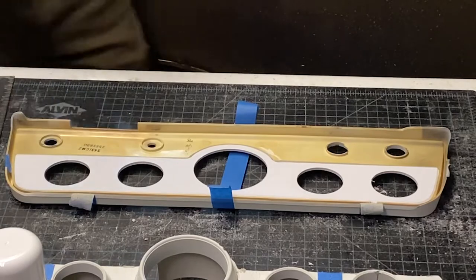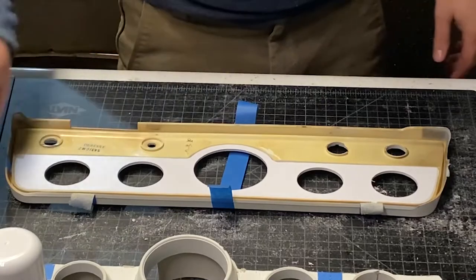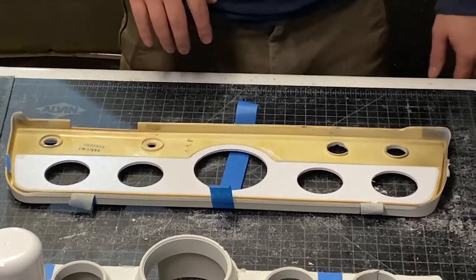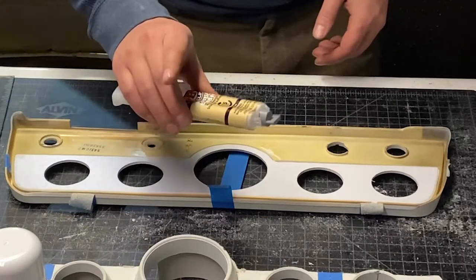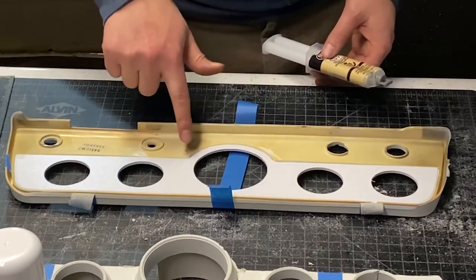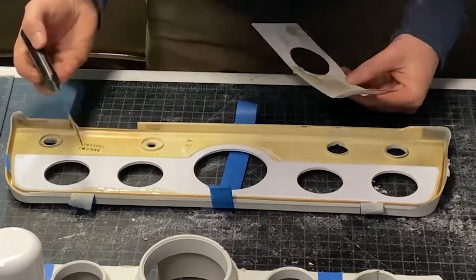Okay. I got a nice chamfer on the back edge here, similar to what you would do if you were welding a couple thick pieces of steel. Get a chamfer so that you can get weld down in there. Got a piece of tape to hold the top edge in, and I'm gonna mix up some of our epoxy, and I think I'm just going to kind of trowel it into the gap, push it down in there a little bit.